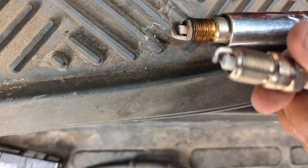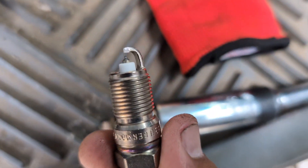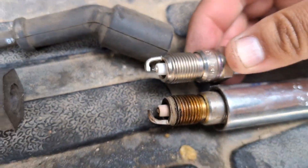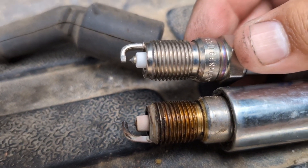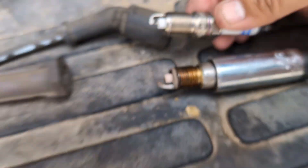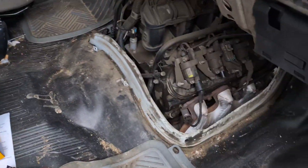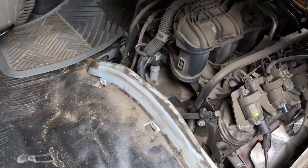Look at the difference — see that electrode, it's almost completely worn down right here. You would have had a misfire probably another 10,000 miles down the road. That's why you want to change them, especially since we're already in here. I mean it's pretty easy — you've already done all that work to get to the engine, might as well replace everything, of course if you have the funds available.